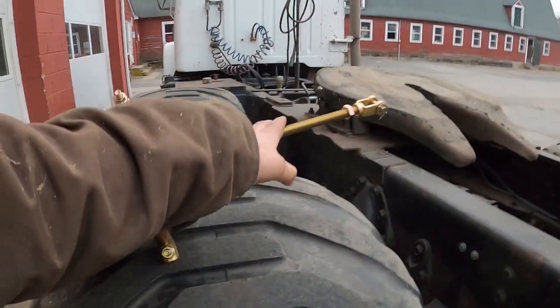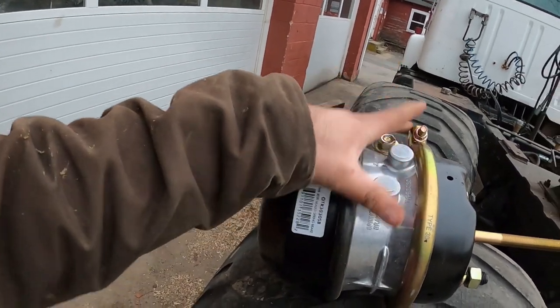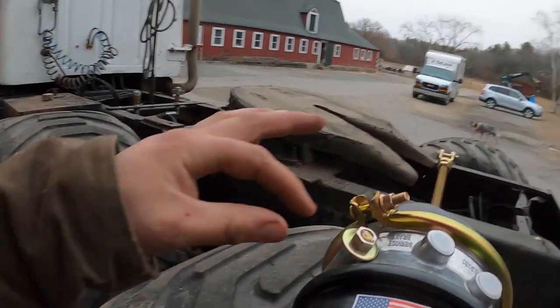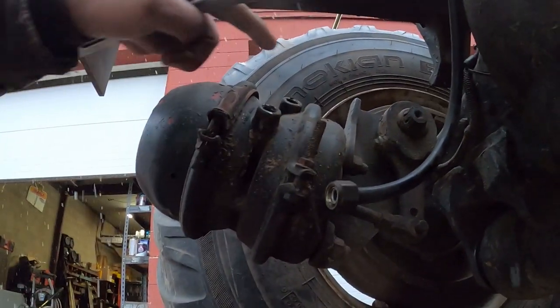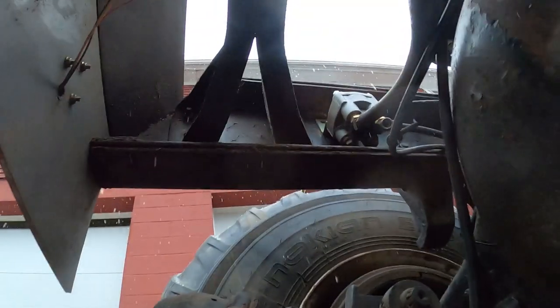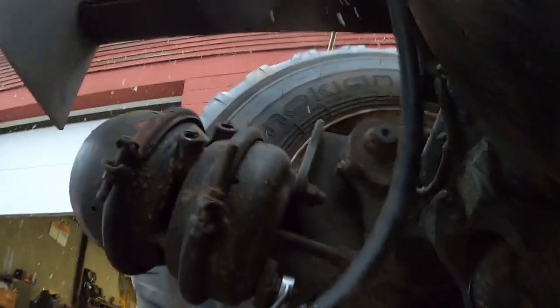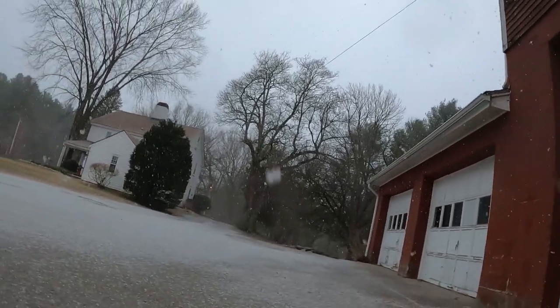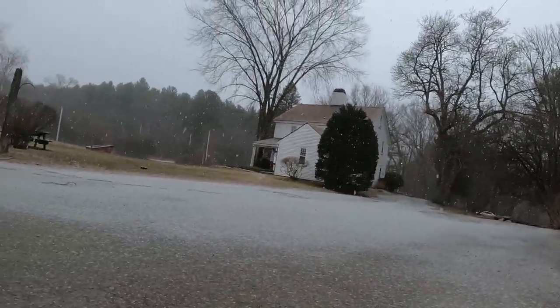This is how a brake can comes — you cut it to the length you need. Always good to get a new clevis with it. You got your mounting bolts, two airlines, and you might have to rotate this around. You got your spring compressor bolt that you put in in case you need to dislodge the brakes. Got the airlines off, got the pin out, had to take one airline off up top. Got just two bolts left to remove and we're done — but it is snowing like anything. It's been maybe five minutes and we already have snow in the driveway.